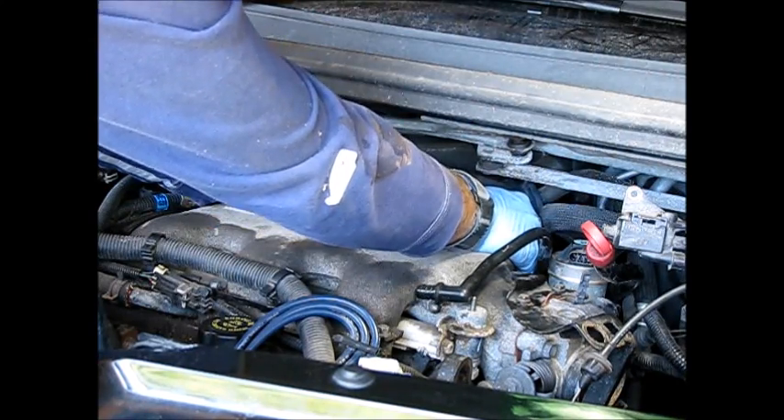It's not turning, and that one's already loose. Let's try the other one — doing a bolt from the left side. Those both came loose; the stud's not turning. Now it's a matter of working them off. As this left-side nut comes off, take note there's also a router for the spark plugs on there. Now turning the other one off by hand — they didn't put anything on this one; it's just doing duty to hold the coil pack. I'm going to get this up and out of here.